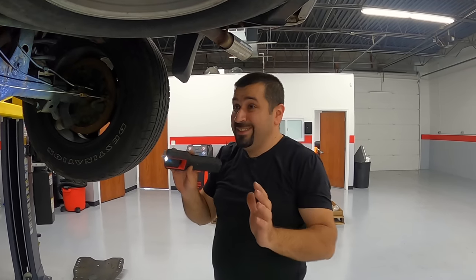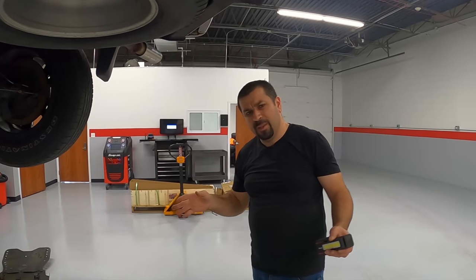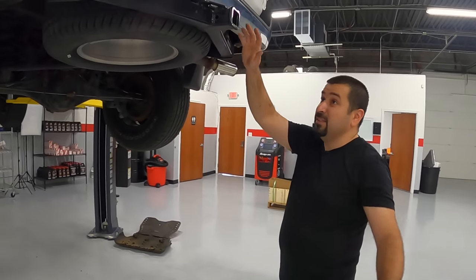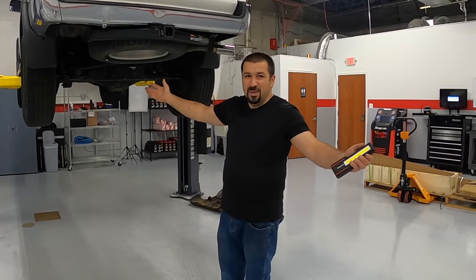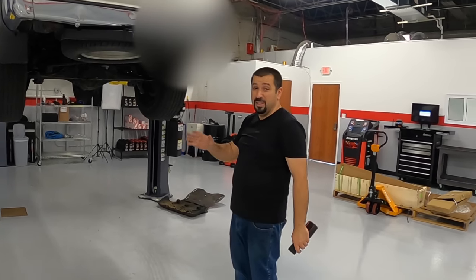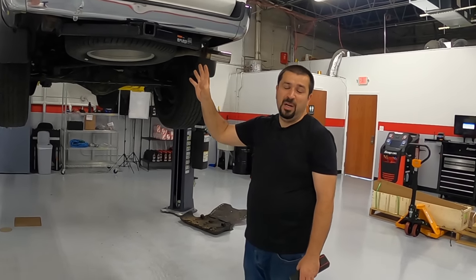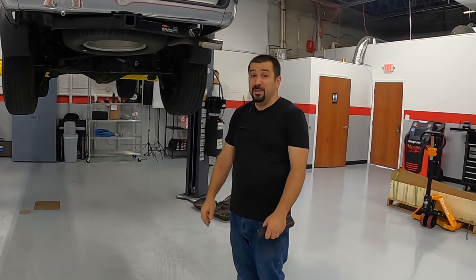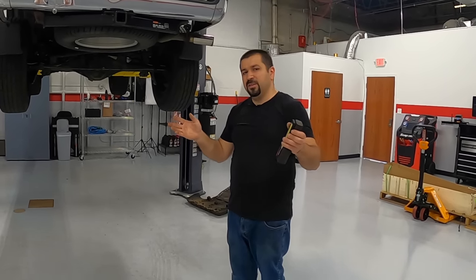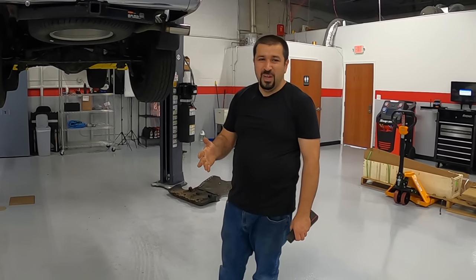Otherwise, these trucks are awesome. Rust kills these trucks — it really does a number on them. The frame, if it's rotten, that's it. There is no fixing that. Unfortunately, Toyota did not cover these like some of the Tacomas and Tundras. This makes a beautiful truck that would otherwise last forever just a pile of junk when the frame becomes so bad — it starts breaking, things start falling off and we're done. If you see one like that, walk away. If you own one like that, time to move on. You can sell it for parts, but please disclose that the frame is bad. Some people will try to weld and fix it — feel free if you're experienced with welding, but if you're a regular consumer driving this car A to B with family in it, don't do that because those repairs usually fail too.